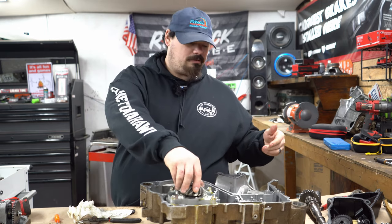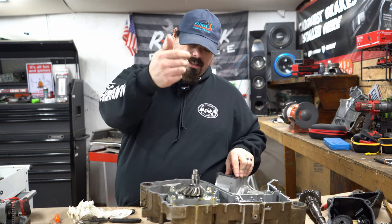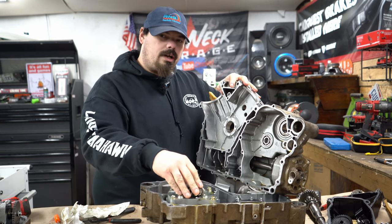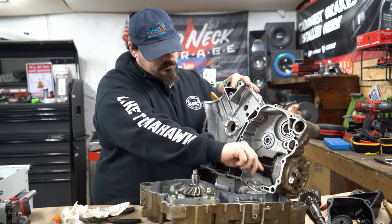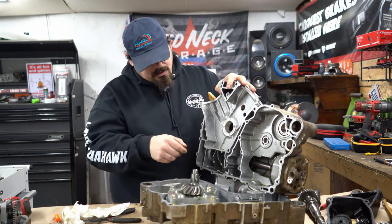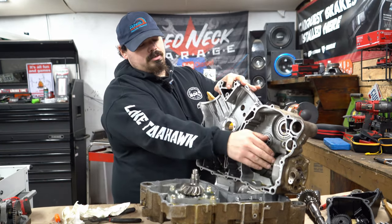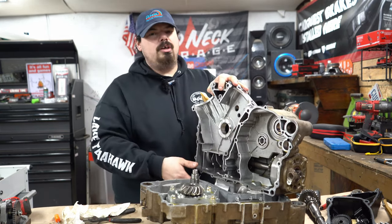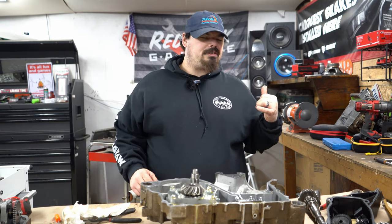This unit here is for your four-wheel drive — this feeds your input shafts. No sense in even getting into there because nothing really goes bad in there. This gear here, which a lot of times is called a snorkel gear, drives this gear here, which drives your input and output shafts. This one does feel a little chunky. This right here drives your output shaft — one goes to your rear diff, one goes to your front diff. Super easy, super simple. The bearings feel a little funny on that.